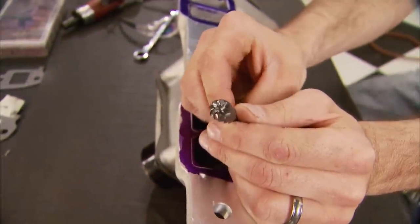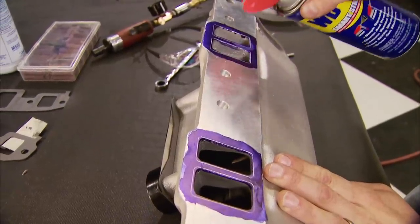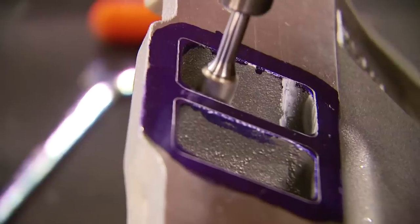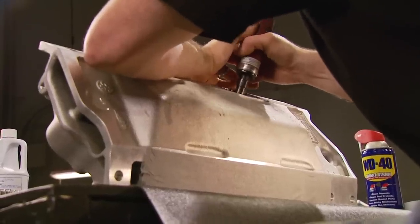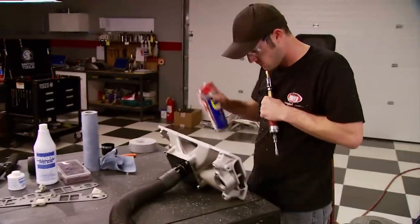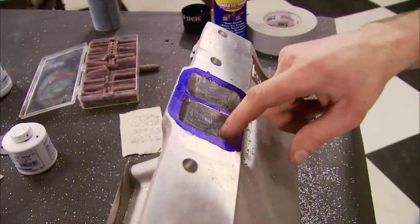The burr we're using is a cylindrical ball nose burr. First, spray the runners down with WD-40 to keep the heat down during porting. Let the burr do the work with just a little pressure on the grinder. To get additional flow, you only need to go in about an inch and a half. After every couple of minutes, reapply the WD-40. When you get close to your scribe marks, swap out the burr for a 40-grit cartridge roll to smooth out the roughness, then move on to a 100-grit for a really smooth finish.